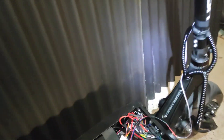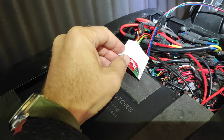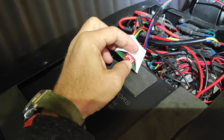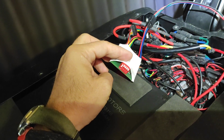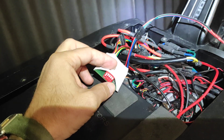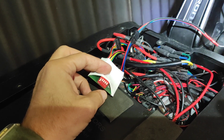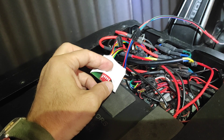Adjusting the offset is done by pushing the left side switch down. Now you are adjusting the offset. When the left side switch is engaged, you are adjusting the offset — you can pull up the right ones. The curve is now remembered; it was set previously. Now you are just adjusting the offset. Let's put this offset higher and higher until we notice the wheel will start spinning even without pulling the accelerator.